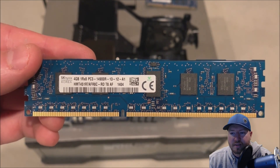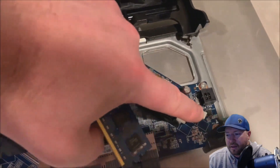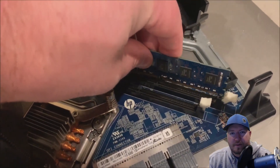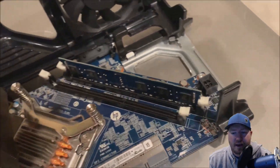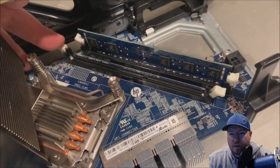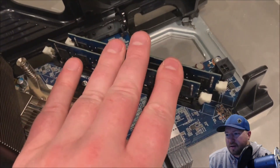All right, so now that we've got our heatsink installed — we kind of fast-forwarded through that — we're going to install four of these DDR3 memory modules, and again these match what's on our system board already. Basically we just have to line up the notches like so and then just click each side into place. If it doesn't click in perfectly it means the notch is probably not lined up. Line up the notch like you see and then shimmy in right to left or left to right, however you like to do it.